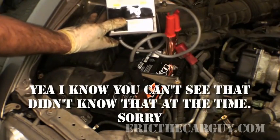As you can see, I have almost 13 volts here now. We must load the system in the same way we loaded the battery, but we don't want to use the load tester to do it — we don't want to load test the battery while the car is running. Instead, we're gonna use all the stuff that the car uses. Every time you turn on an electrical device such as your air conditioning, your window defogger, your windshield wipers, your headlights, your radio — especially if you've got one of those big loud amps in the trunk — any of those things will put an electrical load on the system.